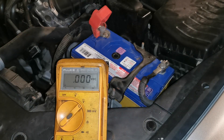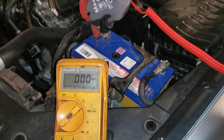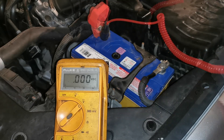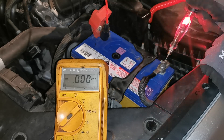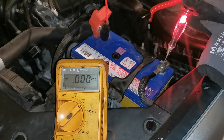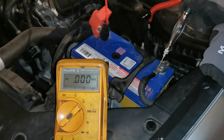The other test is with the test light — we'll put that on to the positive. The result here is simply looking for the brightness of that globe, that bulb shining through nice and bright.